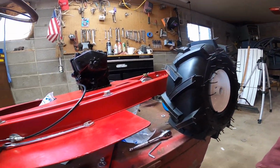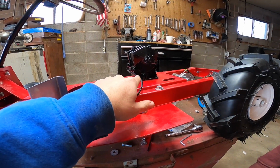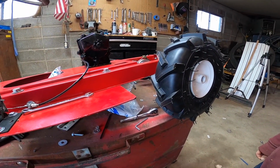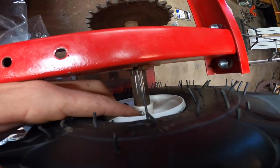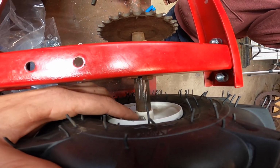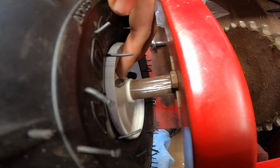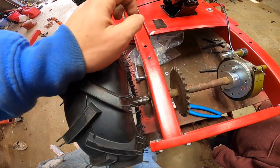Okay, so next video, we'll probably throw the engine on and get the transmission mounted up. I have some bushings I have to put in this axle because they're sliding in and out. There's a little play in it that I don't want. Unfortunately, I had to drill on the inside of the axle for the bolts to go through, and one of them is a little loose because I drilled it perfectly centered. I wish I didn't. This one was not perfectly centered, so there's really no slop. I kind of had to hammer it in. Not a big deal. We'll make something work.